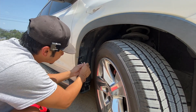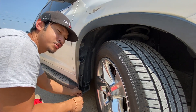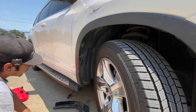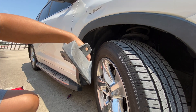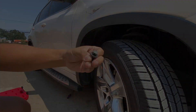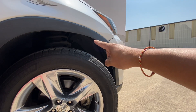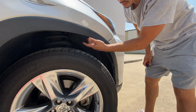It's going to be two of those. Right down here there's going to be a push pin — I'm going to take that off with a flathead. If you guys look at the bottom of this mud guard, that's where I got that push pin. So we're going to go ahead and take off the rest of those push pins. There's going to be one right here.